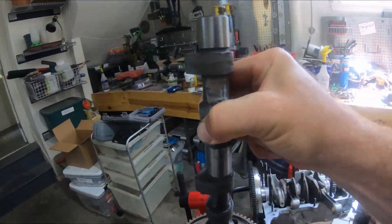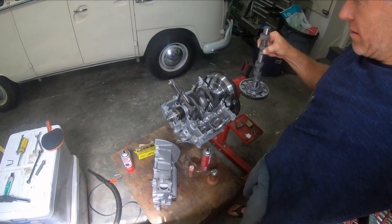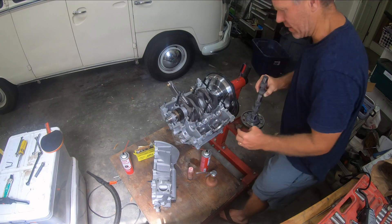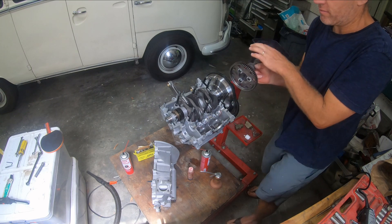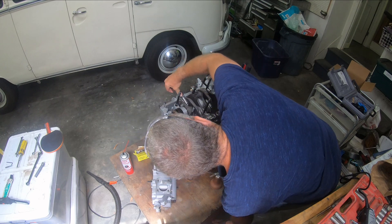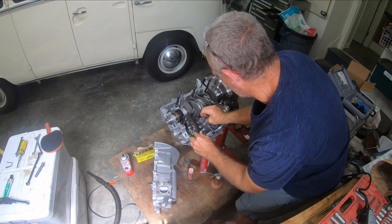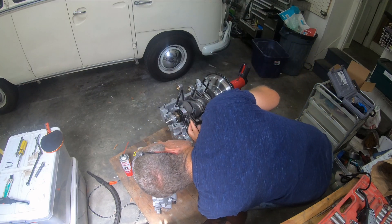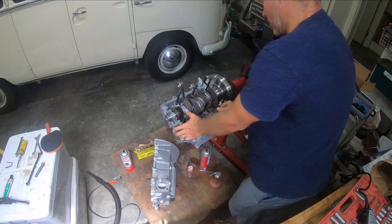This cam, which is an FK42, was already somewhat clearanced because it had flat sides, but it was already really really close with the pre-clearance flat sides. Just throw a little oil on there and get this dot — which is right here — and find the other dots. My dot is in the middle of the other two dots, roll it around, and the cam is in place.